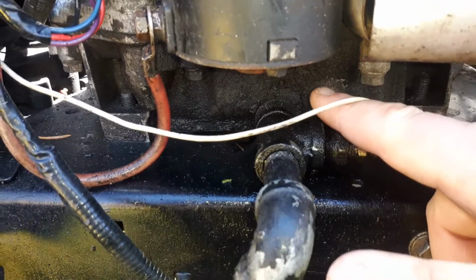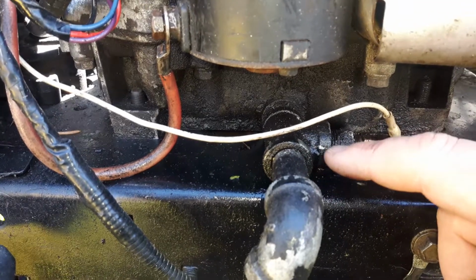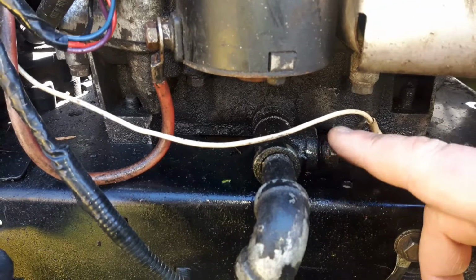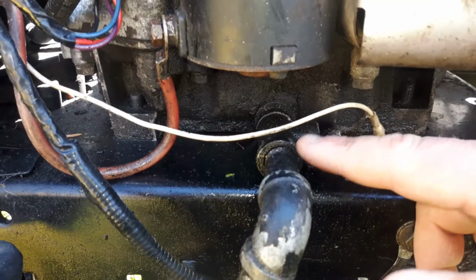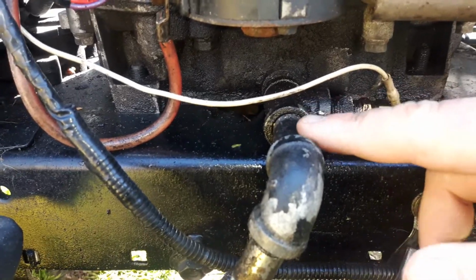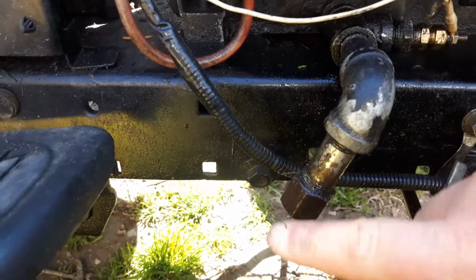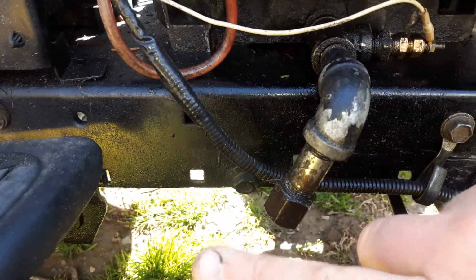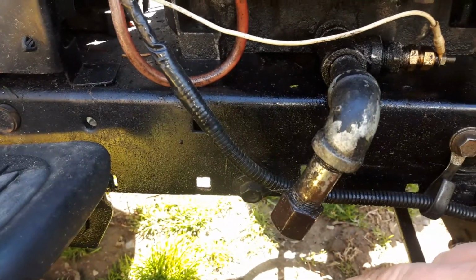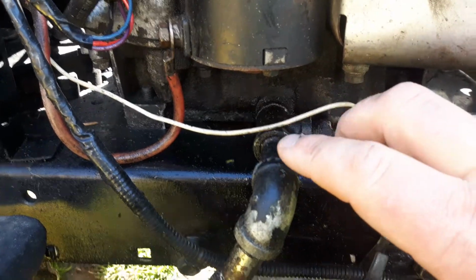So anyways, the piece of pipe is tightened right into the engine, and it comes to this T. Everything is really tight, pretty much as tight as I can get it without stripping it. There is some pipe sealant on these, but even with the pipe sealant, it does drip a little bit. Then you come off with another smaller piece of pipe and you can put your cap, or you can do what I did here, an elbow to a cap at the bottom, which makes it really nice when you go to change the oil, because it drains right down into a drain pan.